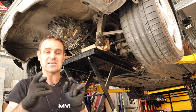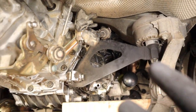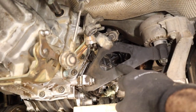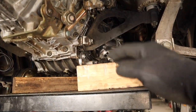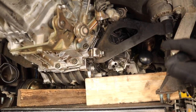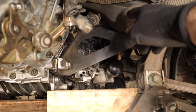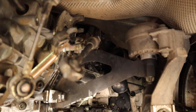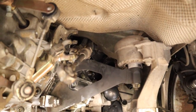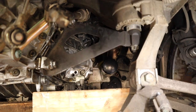Let me take you through and show you some of the little things I'm going to have to do to make an engine mount. I've been doing a lot of research on how to actually mount this up. This is the gearbox at the back, these are the factory gearbox mounts, and the engine at the moment is on quite a steep angle going down towards the front. The gearbox is sticking right up high in the air, and a lot of guys modify these mounts to drop the gearbox down a couple of inches. I've got to get the exhaust through this gap here, so dropping it just makes it fit easier. There's plenty of movement in the drive shafts to drop the gearbox down a bit, so that's not an issue.